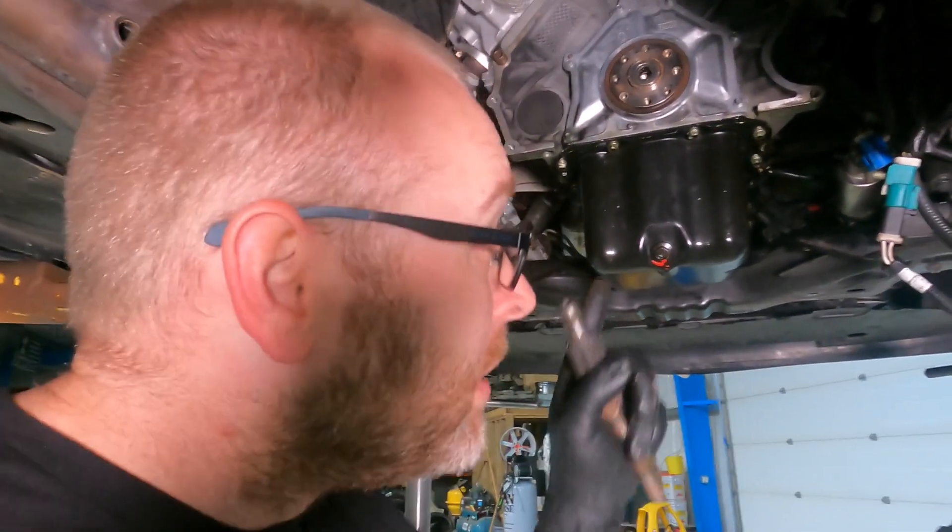We did this job last fall, so I have the old input shaft that he broke — I welded a bolt to it and used it as an alignment tool since I didn't have a 10-spline alignment tool. We're going to jam the bread into that center hole and use this shaft to push it in, tap it with a hammer, and it'll pop right out. The bread doesn't leave any grease — just pick it out with a screwdriver and you're on your way.